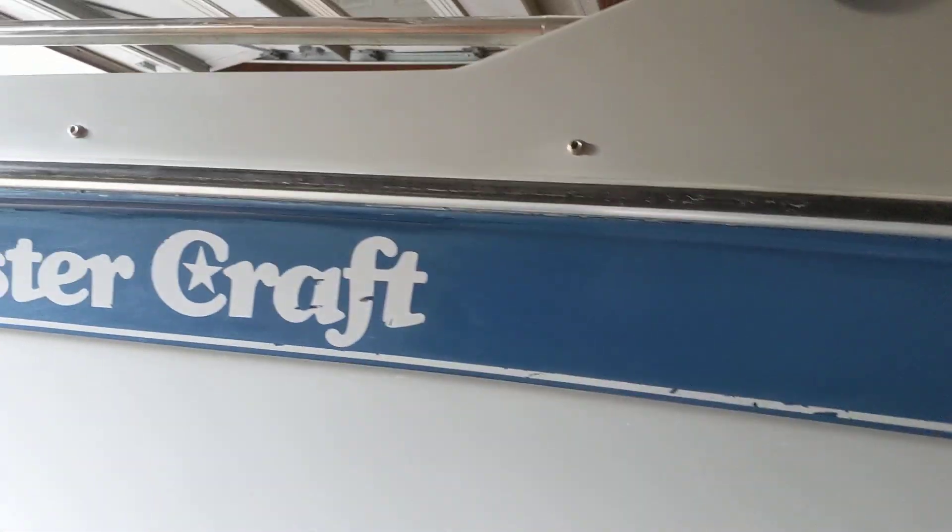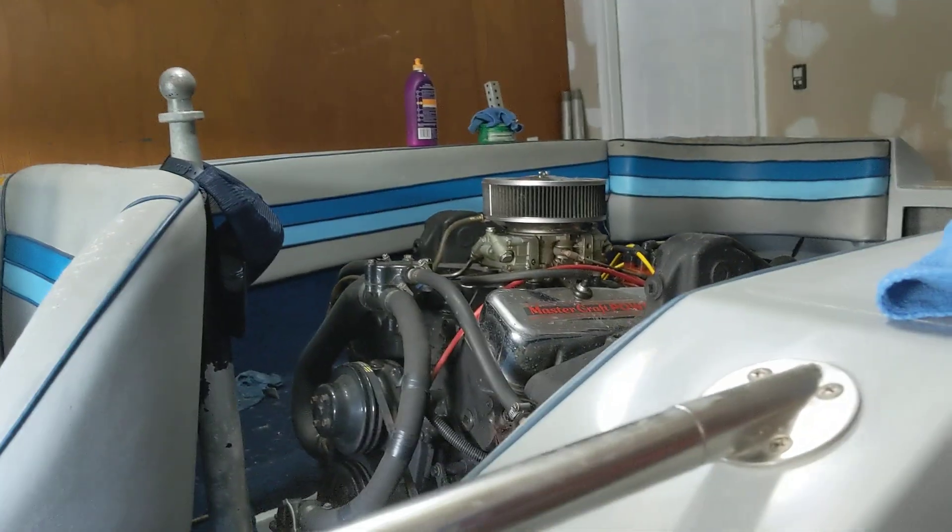Using that material and a good pad, it isn't hard. I fought it before getting the wool pad and the cutting compound, but now that I have those, it's pretty easy. It's not going to be perfect — there's still some oxidation I didn't get deep enough to remove. But the key lesson is: you need to achieve a mirror shine on the first step. If you can't see yourself in it, there is no way anything you do on a future step is going to get there. Everything builds on itself — if you don't do the first step right, the second step doesn't matter.